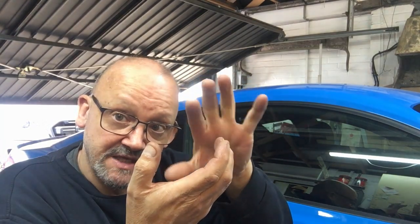Another question asked if plastigauge was good enough to check how spherical the bearings were. First things first — spherical is not what we're looking for, we're looking for circularity. The plastigauge is checking clearance — the size of the gap. Our bearing is like this, the block is like this, we sit the crank in and it sits on the bearing at the bottom. We check the gap at the top — that's our radial clearance. That will be half of the total gap, so if we've got five thou, the radial clearance is two and a half thou.